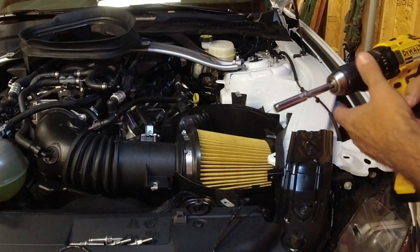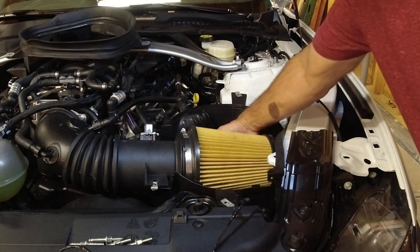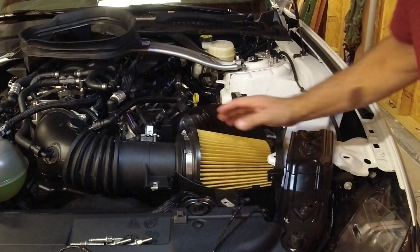I'm just going to show you how to reinsert that tube really quickly. If you pulled your carb trap and want to put the tube back in, all you have to do is pull the air filter and slide the tube back in there — you're good to go. If I'm pulling this air filter, I like to remove the upper lid of this air box only because it allows me to get the air filter to seal correctly.